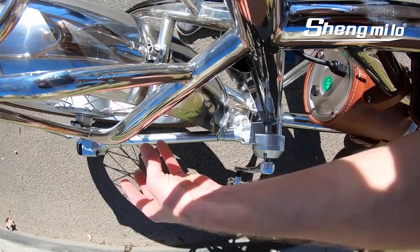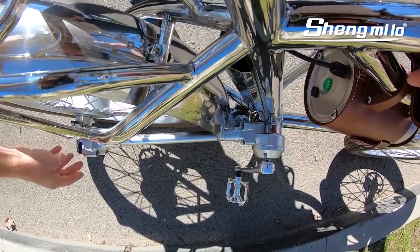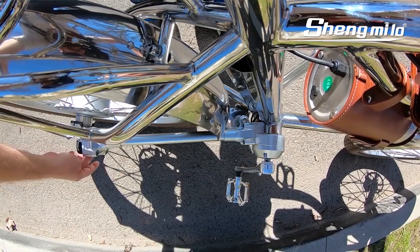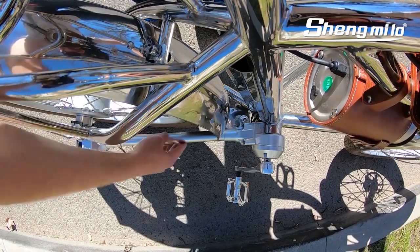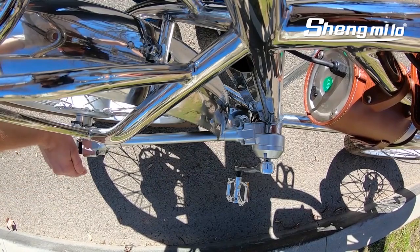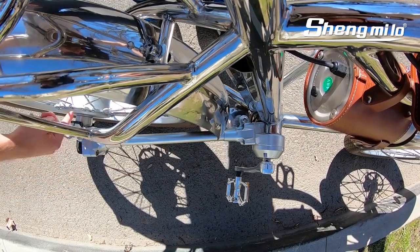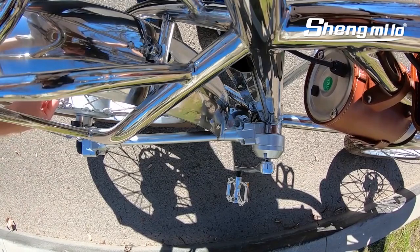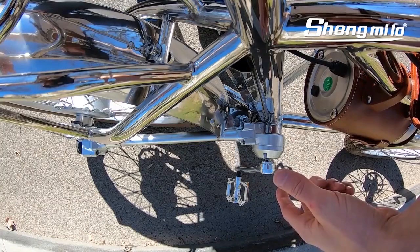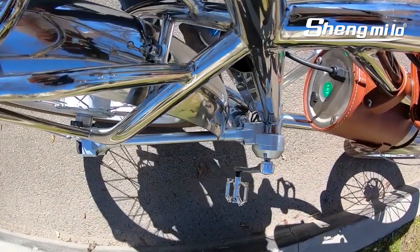You might hear some of that rattle — it didn't do that on the Retro S, so maybe it's just this unit or the plastic gears. Didn't feel a ton of drag. The motor power cable goes down and has a pretty sharp bend to get around the shaft housing — that's going to protect it almost like a derailleur guard would, but that sharp bend is a concern. You don't want that to break because the motor won't work. The motor has a DKY label but it might be a Bafang fat tire motor. 500 watt — going into highest pedal assist level 5.